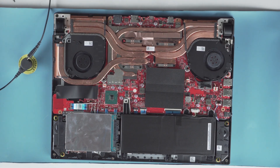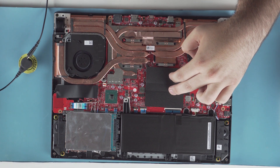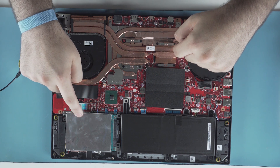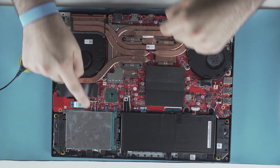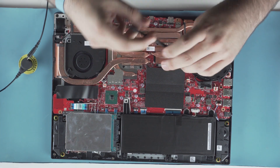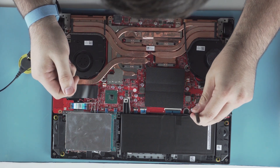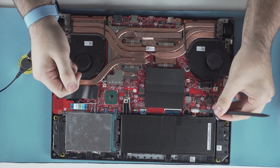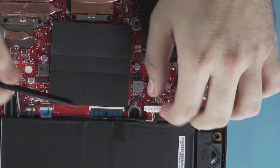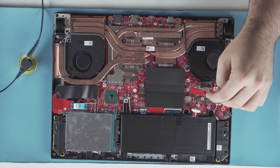Alright, let's get to doing some upgrades. We're changing the RAM from 8 gigs all the way to 32 gigs, and we're going to add an NVMe drive. We're also going to update the storage drive from the base 1TB to a 2TB. First things first, you're going to want to remove the battery. Be careful with these ASUS models — they have a metal tab you actually need to move back. You don't need to take the battery out of this model to perform these upgrades, but it's good to have it disconnected.